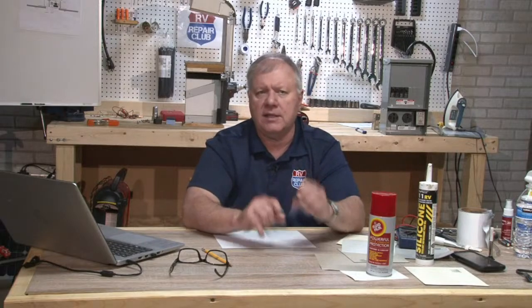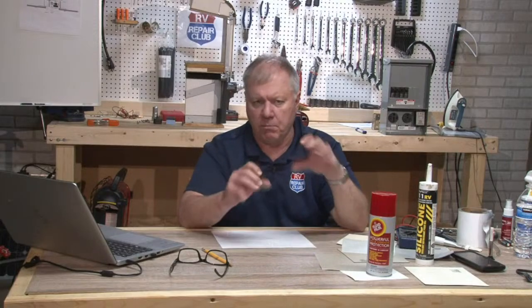So if you're going to upgrade and you're looking at the wet cell batteries, I would definitely get a multi-stage charger from something like Parallax or Progressive Dynamics, their Charge Wizard, something that does a desulfation stage. It does a high output at the front, and it boils and breaks up that sulfation. Then it goes through an equalizing stage and a float charge. The step up then would be to go to AGM batteries, which require less of that, but you're probably doubling the price when you're doing that.